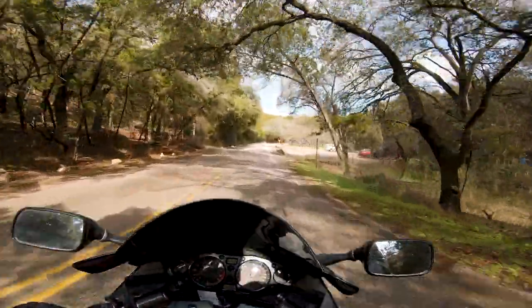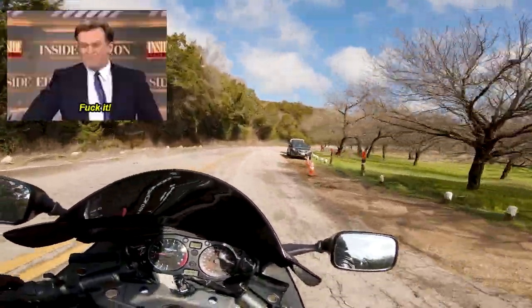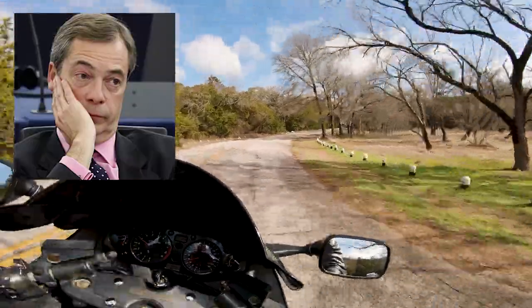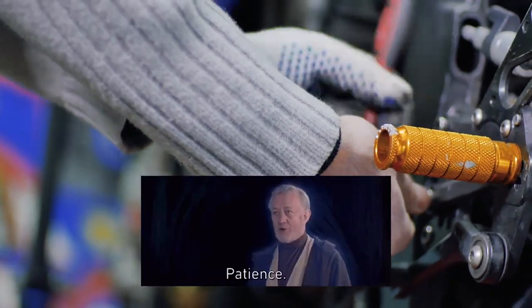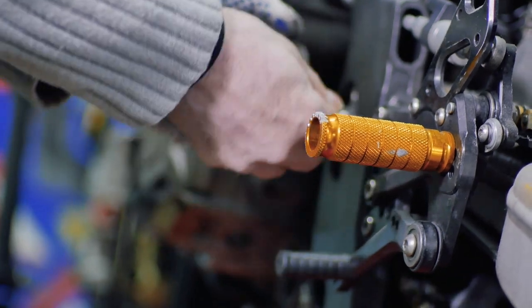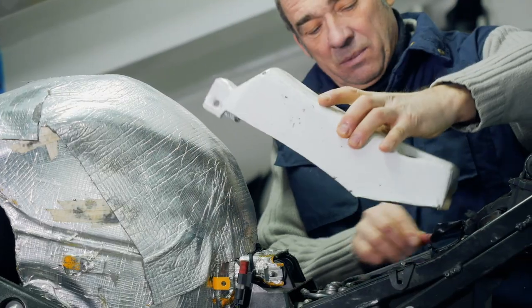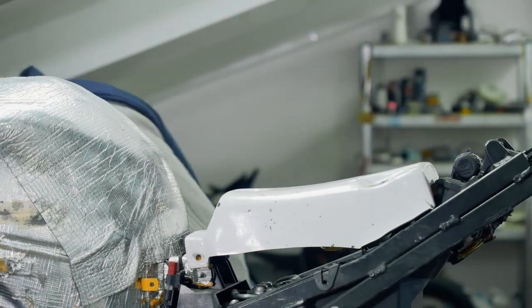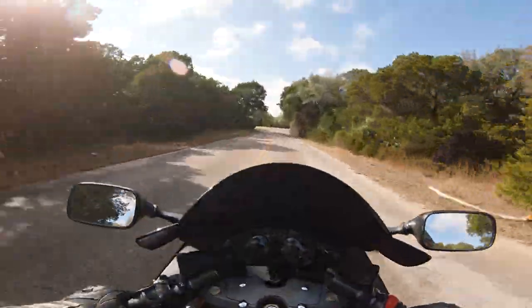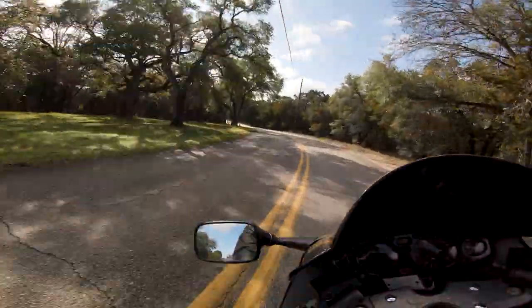Patience. Patience is a tough one because as a job goes on longer and longer, you just want it to be done and it's really easy to get into that "eff it" mindset. What's the torque spec for your header bolts? Eh, eff it, it's good and tight, it's not going anywhere. Whoops — looks like your exhaust pipe fell off. Aren't you supposed to use a fresh crush washer every time you do an oil change? Eff it, it's fine. Now you're leaking oil all over the track and gonna have to pay that cleaning fee. Have the patience to see a job through with the same level of care from start all the way to the end, especially once the end is in sight. Nothing sucks more than having to go back over a step because you half-assed it. There are places where "good and tight" (GNT for short) is okay, like seat bolts or mirrors, but if you're monkeying around with critical systems, it'll really pay dividends to break out that torque wrench and get that bolt into spec.